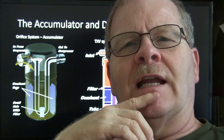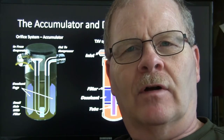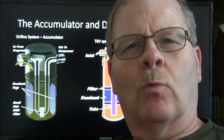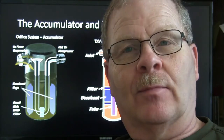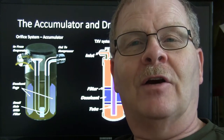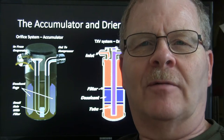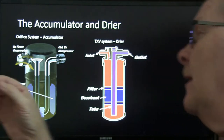Now, when the compressor is mounted low, Ford has a strategy called CASS, where whenever you're spinning the engine over, it energizes the compressor and starts moving those pistons to slowly work out any oil that may have settled into the compressor. Because if the compressor kicks in real hard when there's oil in there, it might slug it and cause some kind of damage to the compressor. Ford was concerned about that. They got a compressor anti-slugging strategy, a CASS, in case you weren't familiar with that.